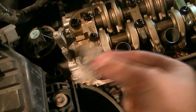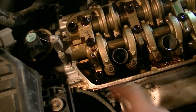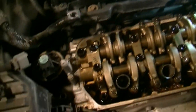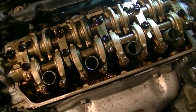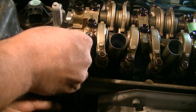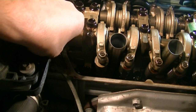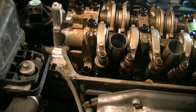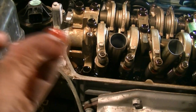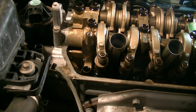After you use your razor blade to clean those corners, get a rag with some brake cleaner and go around to get all the old goo and caked-on engine oil off this mating surface. You want to make sure none of this old RTV silicone ends up in the engine, so grab it with your hand if you have to and just get it out of there.